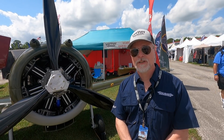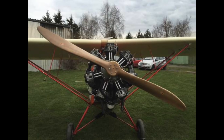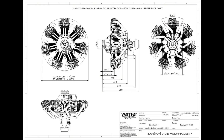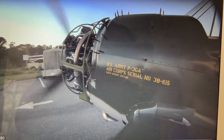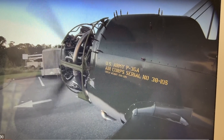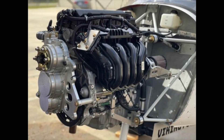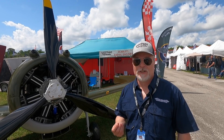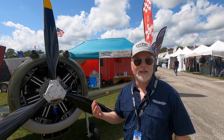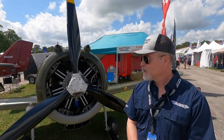We're a dealer in the United States for Verner Motors, out of the Sumperk airport in Sumperk, Czech Republic. It's a father-son operation; they've been producing experimental aircraft engines for about 30 years and doing radial engines for the last 11 years. We created the P36 around the Verner seven-cylinder, but for the P40 version — which is just a firewall-forward difference — the Viking 150 is a great option, and Aero Momentum has an AM15. Those engines are around 148–150 horsepower and the weight is right in the zone. This scale was specifically picked for the number of engines available.